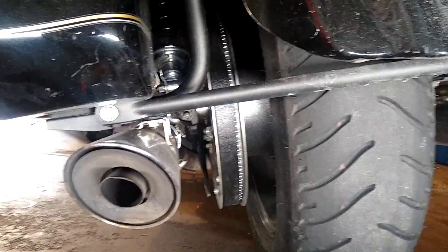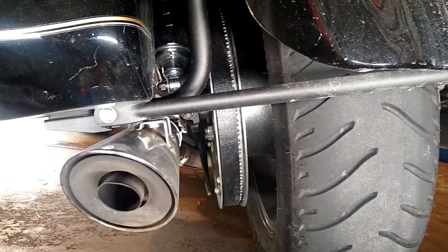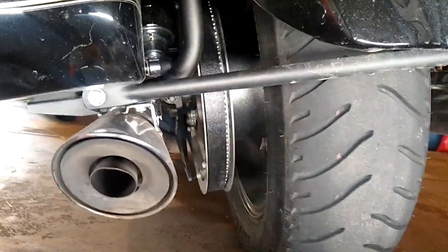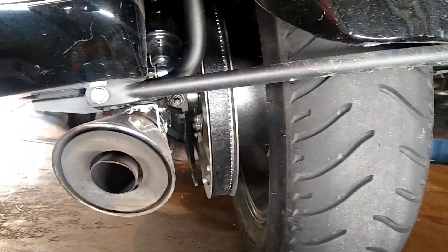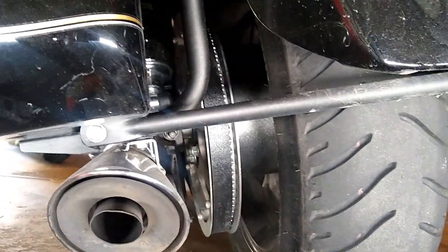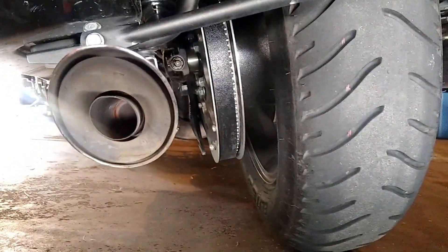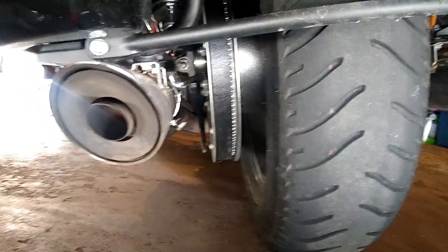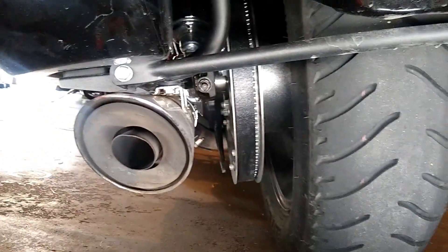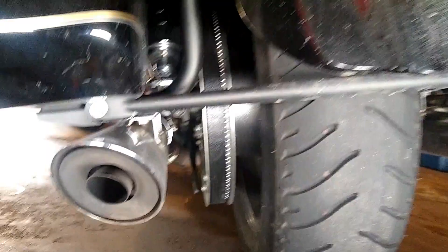We're not really concerned about the strength of the belt at all. He's had it on here for a few weeks now and it's been working just fine — we have no regrets. It doesn't travel around, doesn't make any noise or do anything strange, it works perfectly. So if you were wondering if you could save money on those expensive Kawasaki belts, you can — get that Harley belt. It's a 139-tooth, one inch wide. Good luck everyone!